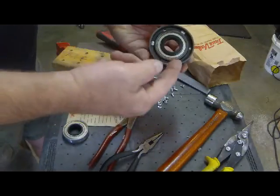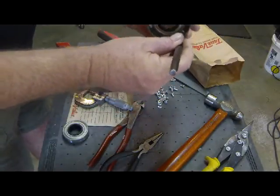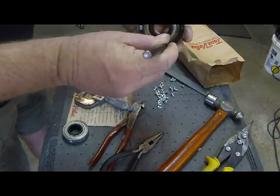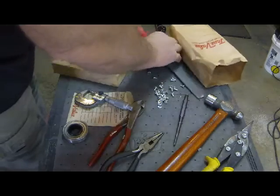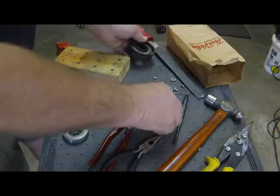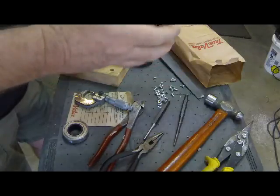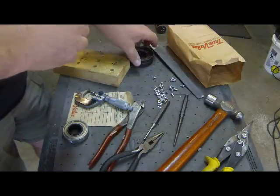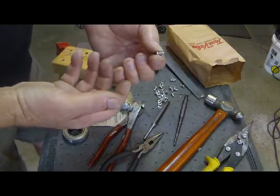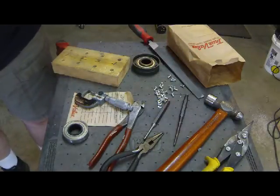We're going to back those up, or what's commonly known as bucking, and we will do that with a punch and punch in the vise on one side, and then we'll come down with a punch on the opposite side, and where these two forces are concentrated, that rivet's going to swell in the hole, and then the top of that long piece of the rivet is going to mushroom down and effectively hold our pieces together. So I'll move over to the vise with that one and see you in a second.